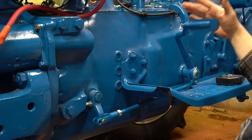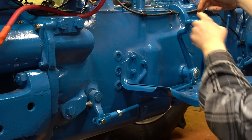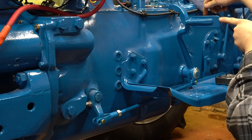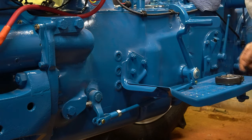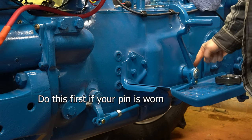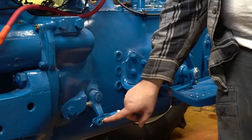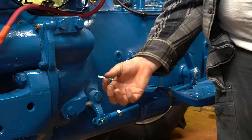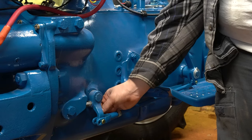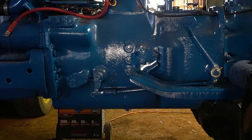Set your free travel first, then do your pedal height. Measure your free travel from the kick-up to the pedal using the top edge, and pedal height is from the flat of the running board to the center. Tighten everything up and pin everything, then pump your pedal full of grease so you don't forget it. If you plan to sometimes switch between single and double clutch, instead of running a cotter pin like the manual calls for, just put a hair pin in so you can take it in and out easily. I'm just going to run the cotter pin - it's all adjusted and ready to roll. I'll crank it up and let you see where it engages and disengages.